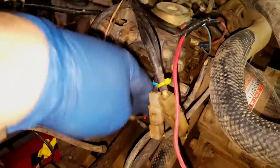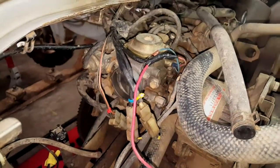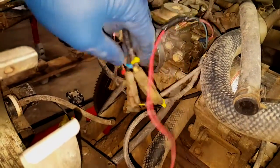The air cleaner box is out. I went ahead and color-coded the cables that need to be attached or detached. This one goes to the auxiliary electric fuel pump and it's connected to the fuel shutoff valve in the carburetor — at least they took some safety precautions there. Then I've got this hose and I'm not sure where it goes, so I'm going to disconnect these cables now.